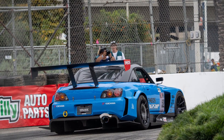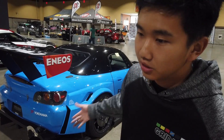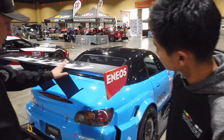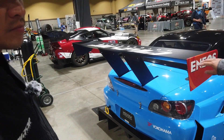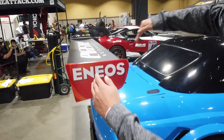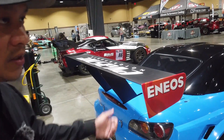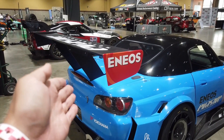The rear wing and diffuser dominate the whole experience of the car. The strakes go all the way to the front axle basically, and there are huge tunnels for generating downforce. The rear wing is also part of the Voltex kit — this is a 2000mm Type 13 dry carbon wing. It's a very long chord but relatively flat and smooth, so it's kind of low drag for what it is.